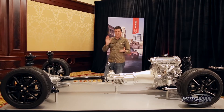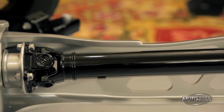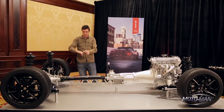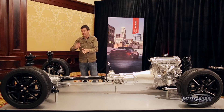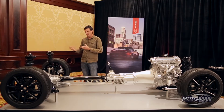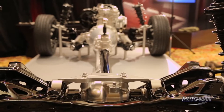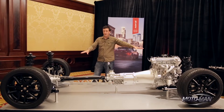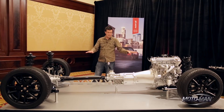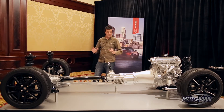When you're getting on and off the throttle, those quick transitions are loading and unloading the engine mounts, transmission mounts, and diff mounts. The diff mounts are the trickiest because the diff is putting all this torque into the rear wheels and the reaction is lifting the nose of the diff. If you just have a rubber mount there, it has to hold the nose of that diff down. You can make a really stiff mount to hold it, but then you get all those gear noises transmitted into the car. By connecting the transmission and diff with this rigid frame, we're holding the nose of the diff down with the entire weight of the engine. We take all those torque reactions and cancel them out, so we're able to tune a much sharper throttle response without all that wind-up.